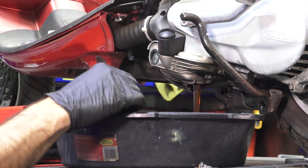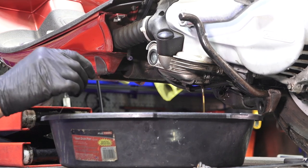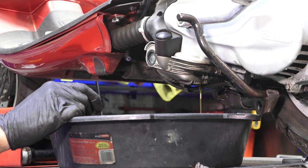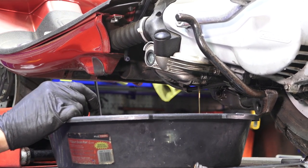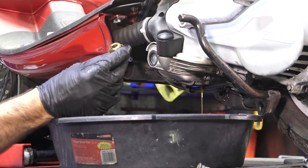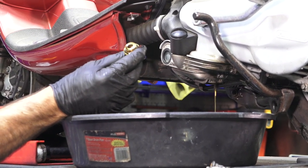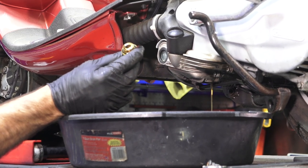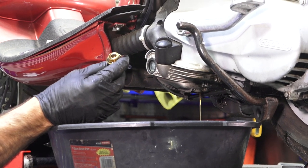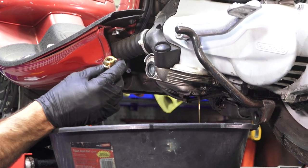The oil looks pretty clean, but with that moisture in there, that concerns me. I think I'd do an oil change, get it to a point where I can ride it, put maybe 50 miles on it, and then drop the oil again — which would be a good idea. They do have an oil drain O-ring on any of these drain plugs; it's a larger size on the newer motors. For newer Vespas 2001 and later, I use an O-ring in the 285/238/239 range — a very popular part. Anytime you do an oil change, have one of those O-rings on hand.